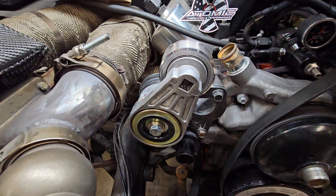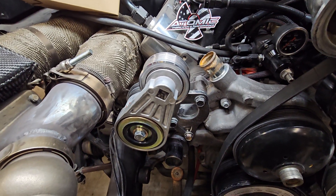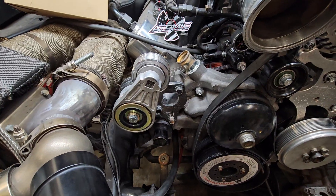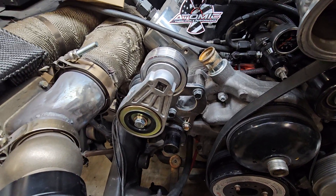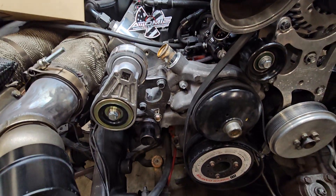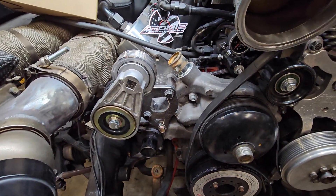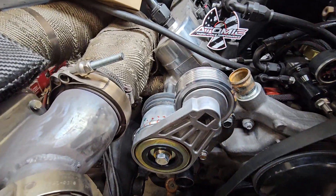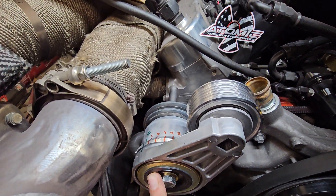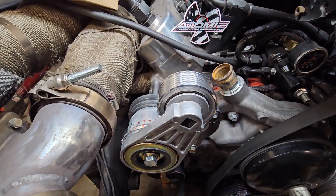So why do you do this kit? It's mainly for high RPM, naturally aspirated, or supercharged guys — especially LSA or ProCharge. The process will be a little bit different with one of those, but the concept is kind of the same: basically ensure we get the most travel in the tension direction by using the right length belt.